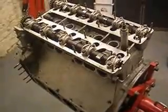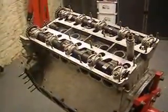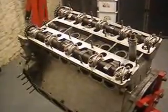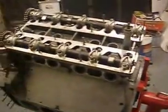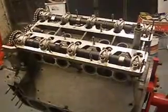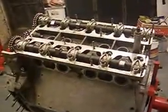The left side of this engine is where all the problems are. One of the cylinder heads is pitted, and when Gary took the cylinder head off he discovered that there were all manner of studs used on this side. Looking at the manual, this is an early engine and it needs gold-coloured studs not black ones, so when we come to rebuild this engine, this side is the one that needs all the attention.